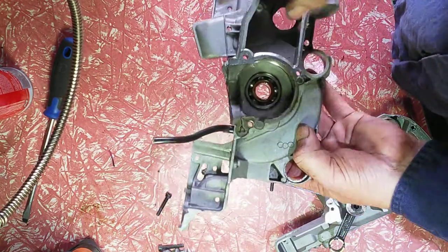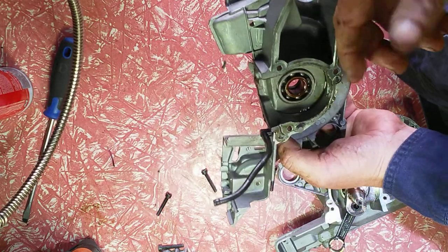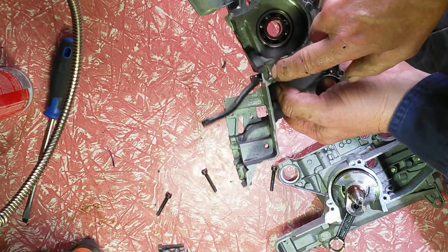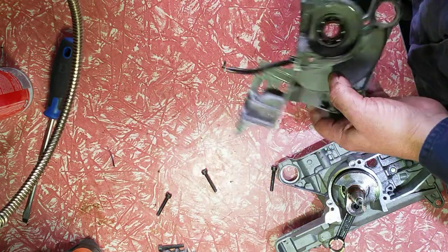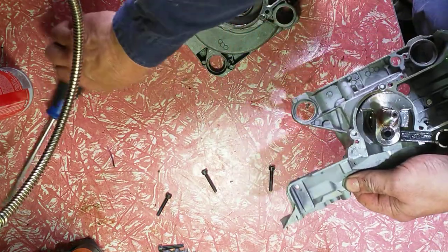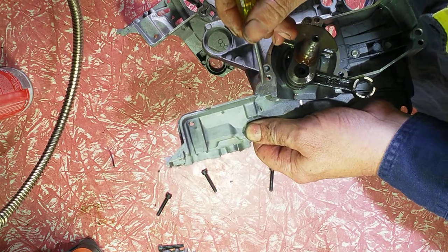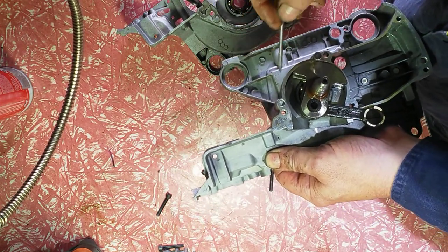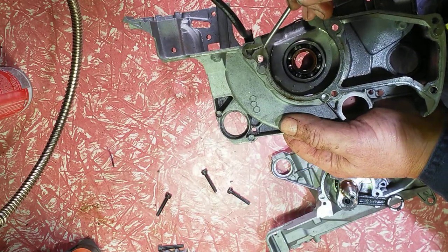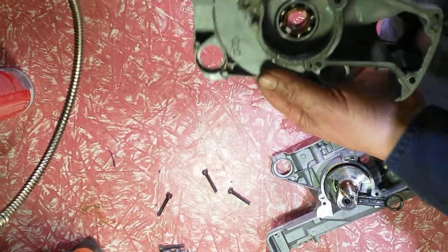There was a gasket — very thin. I'll clean it up with petrol degreaser. When you're doing porting, check everything where the pulse line goes through. The carb pulse inlet is just here, so make sure it can actually go through. You've got to make sure things stay sealed, so that gasket goes around the outside. It goes around here and provides a seal. Your pulse line takes the pressure from your crank and throws it up through the pulse line, so I'll cut this hole out just a bit, and that groove there. As long as I keep that gasket around it, it will stay sealed.